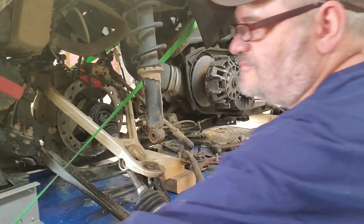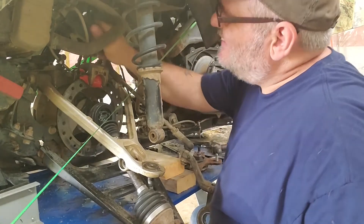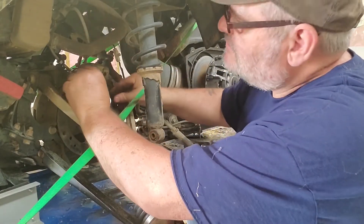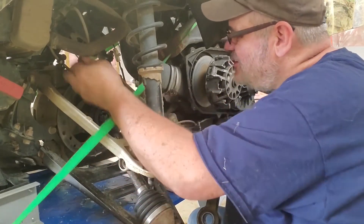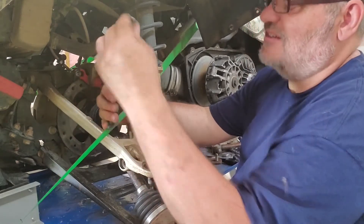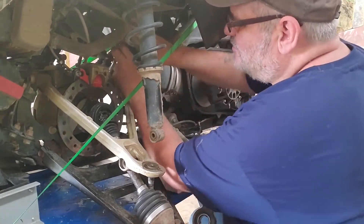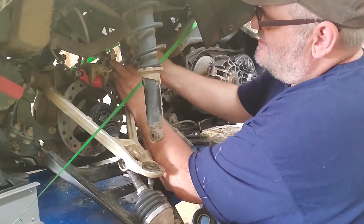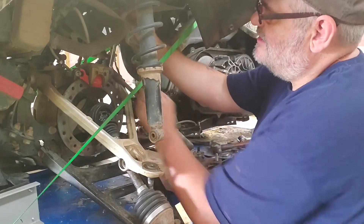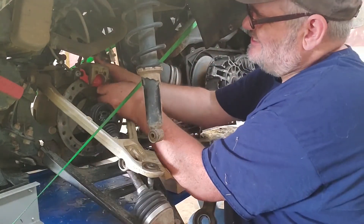Okay, so the next thing is to take the brake caliper off. This is why I prefer Allens over Torx - they're not great either but they don't tend to break. You strip, but all things being equal they're a lot more cooperative. That 12mm wrench on this side doesn't want to cooperate. There we go. I did not want to have to heat that - there's a little rubber boot down there that does not like heat. Now normally if you pry up on this enough, that will come off.